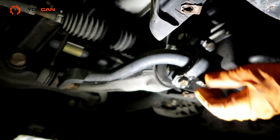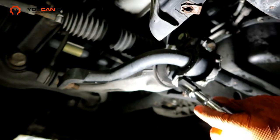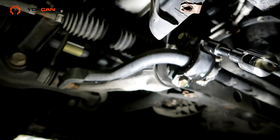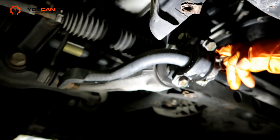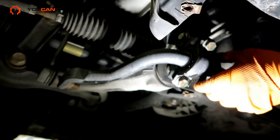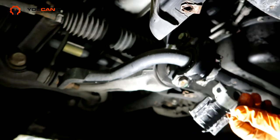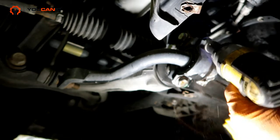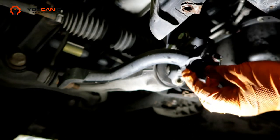For these two 18-millimeter bolts you might even need a breaker bar to break them loose. When you reinstall them, you need to torque them to spec. Once you loosen those two, the next thing is to remove these two nuts — you'll have to counter-hold these on the back, otherwise they might start spinning, especially if they're rusted. Once you remove these two, you have two halves that just come apart, and you simply reinstall it in reverse order.